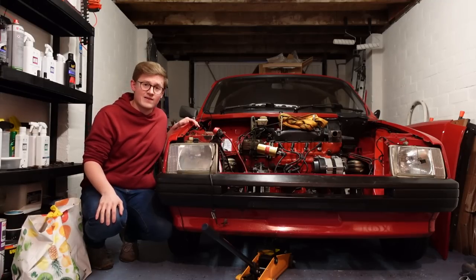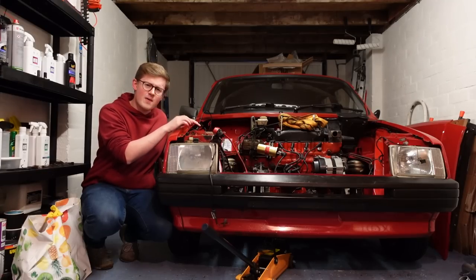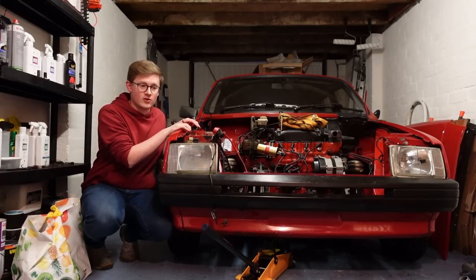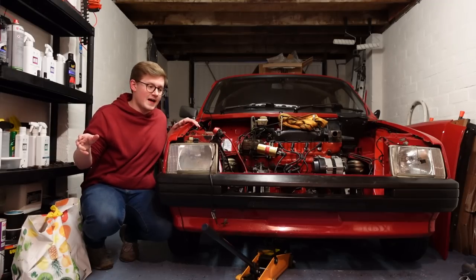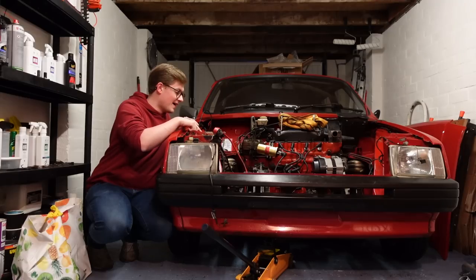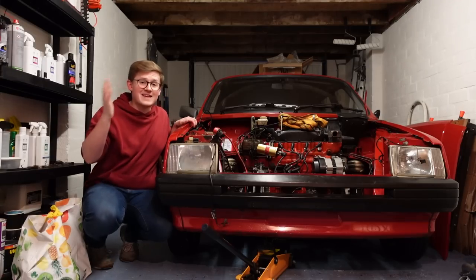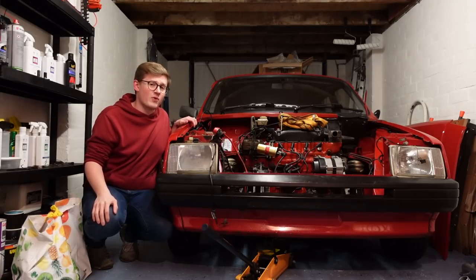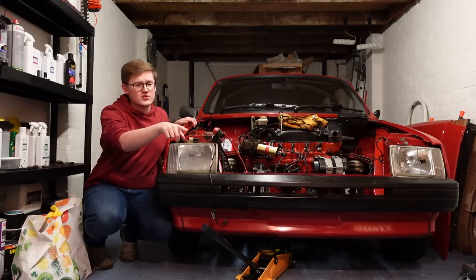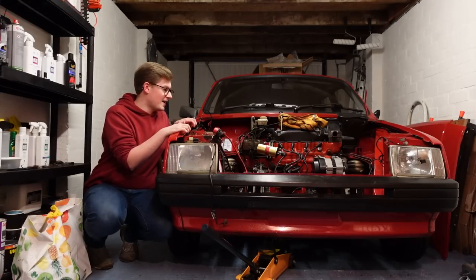Not all today, but I have a few minutes out here in the garage, so we're going to bolt the clutch and flywheel to the end of the crankshaft. I can't remember whether I mentioned on camera why we didn't have it all buttoned up when we put the engine in the car, but essentially I sent the old clutch off in exchange for a new one, and accidentally sent off the flywheel boss that allows you to tighten the bolt on the end of the crankshaft. That's an idiot move on my behalf. So now that I've rescued the flywheel boss and all the bolts, it's all bolted back together just off camera - I had to do it in a vice at my grandparents' - and now we can put it back on the side of the engine.